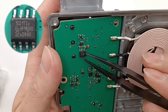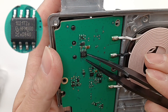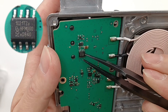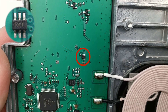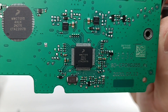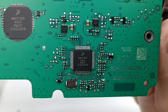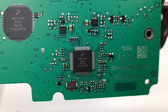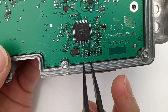Then, let's introduce all the components. The protocol controller comes from NXP TJA1021, which can work with the master control chip to control the wireless charging and reduce energy consumption. This is a bi-directional high-precision current sense amplifier, which comes from Texas Instruments and is used for input current detection. The master control chip comes from NXP MWCT1213AVLH. It can support wide-range input of 5–24V, and Qi 1.2.4 standard. The maximum output power is 15W. Those are passive crystal oscillator and some external components.